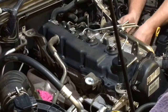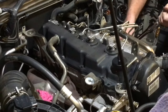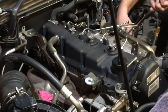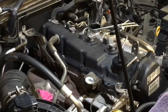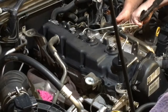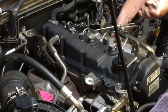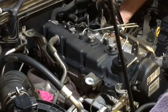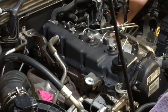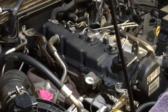And if it doesn't feel right, which is a bit hard for you guys. Yeah, that's pretty right. They are nice and soft when they're new, so I don't think you're going to have an issue, as I said, with Bailey's online guide, 25 newton meters. If people are doing that and not having any issues, chances are maybe you can get away with 25, but I'm not going to start telling people that, because 32 works. That's the workshop manual, the Toyota genuine way to do it by the engineer, so that's how we've done it. Now all those fuel pipes down there are done.